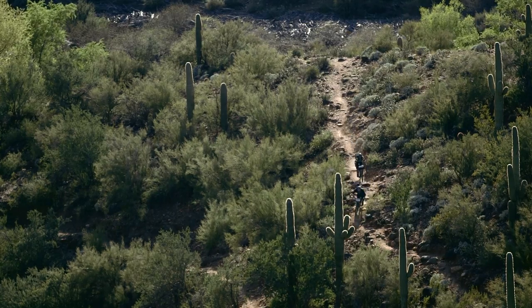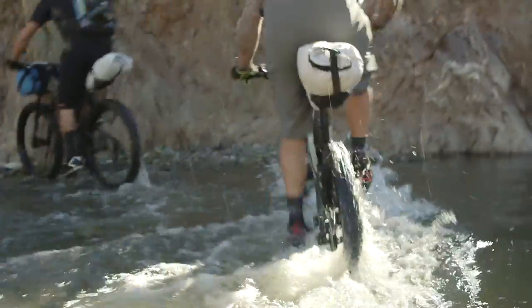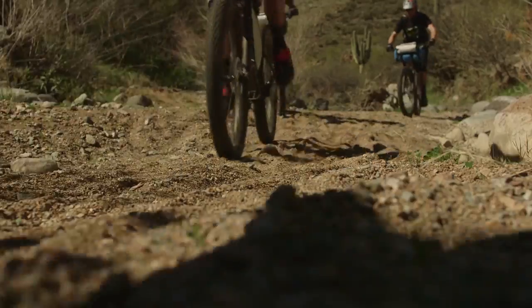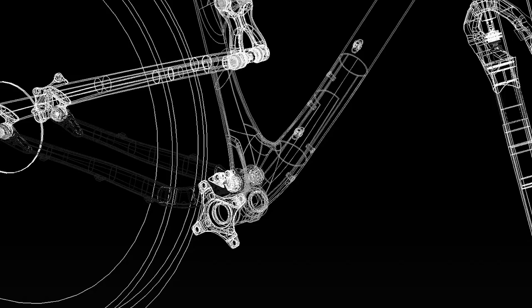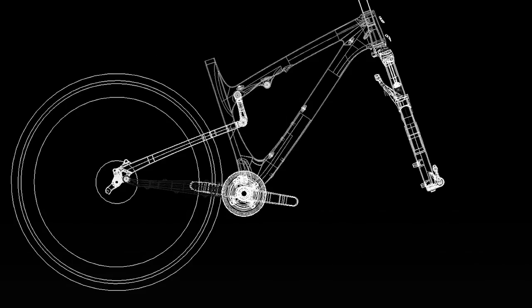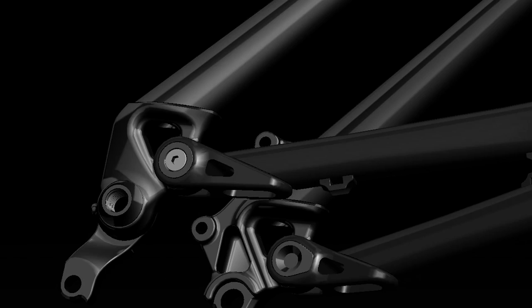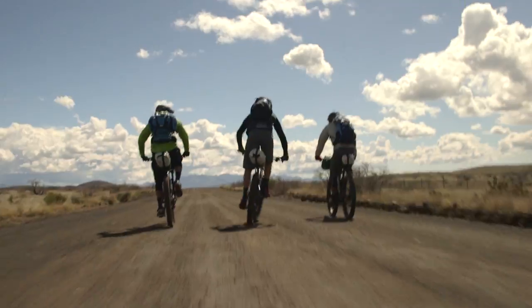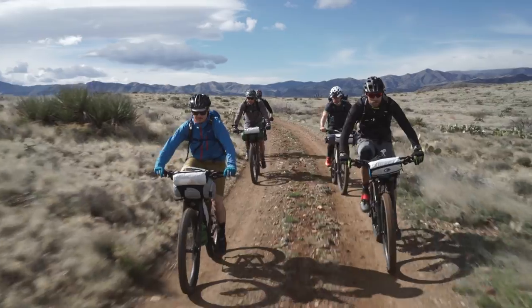27 Plus is essentially an oversized 27.5 tire and the outer diameter is similar to 29 inch. That's why we were able to adapt one of our existing platforms, the Element, and morph it into this new Sherpa concept. We sat down at the computer and had a good long look at the geometry and the tire clearances to make sure it would all work. On the rear end of the bike, we spaced it out to accommodate 3.25 tires with a front derailleur and a two-ring setup. This is an off-road touring bike — you want a super wide gear range.